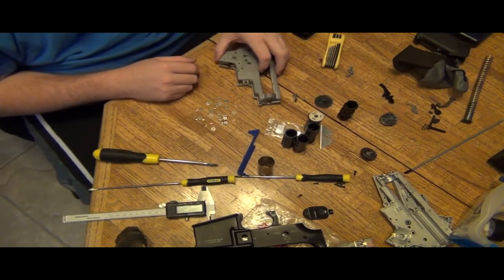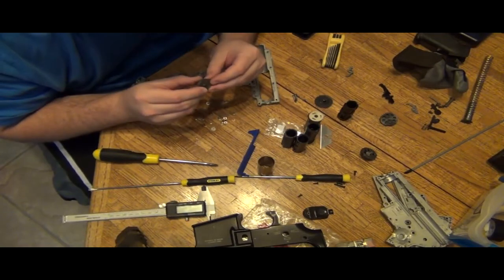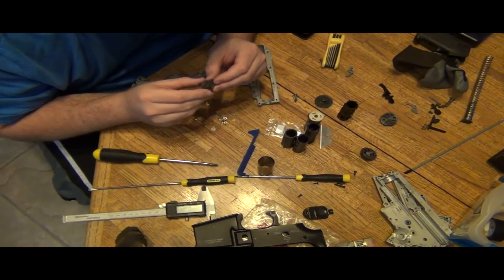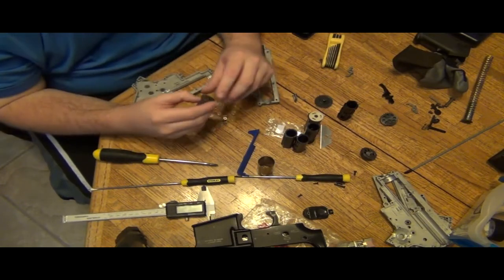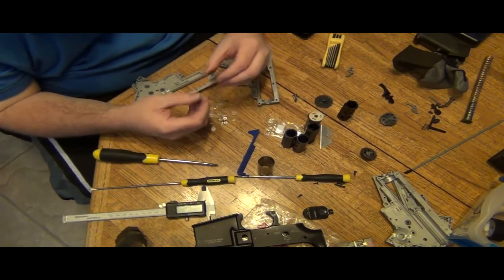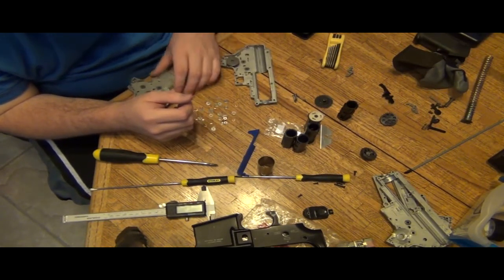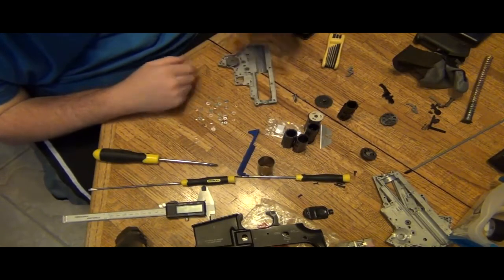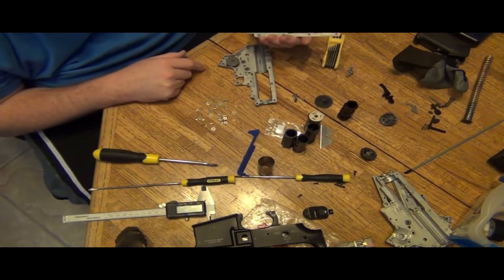Okay, so I don't actually remember how many I put on there. I know there's a 0.3, 0.2, another 0.2, 0.2, and maybe a 0.15, I'm guessing. But again, those aren't exact, so it's quite a bit in this shell with this type of gear. And I think that's not an original GR16 gear, and this is a CM16 gearbox.